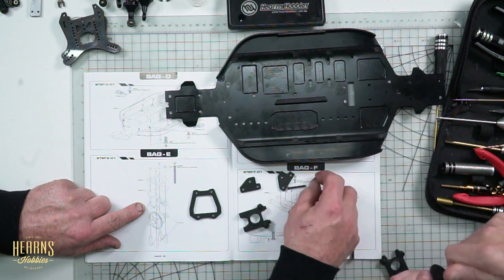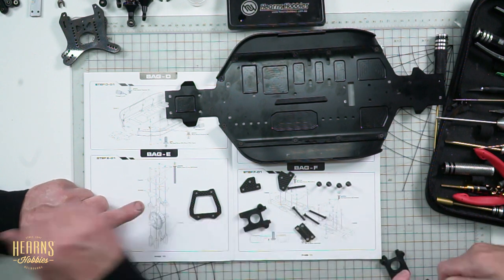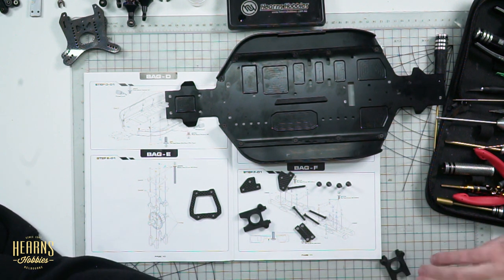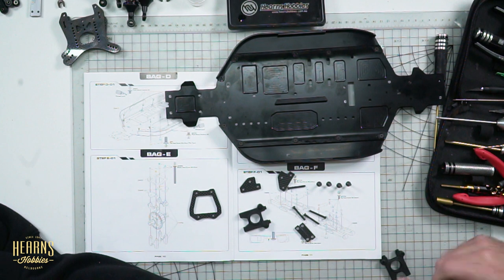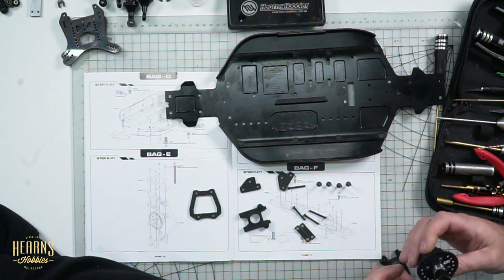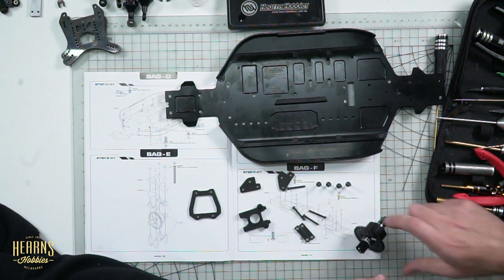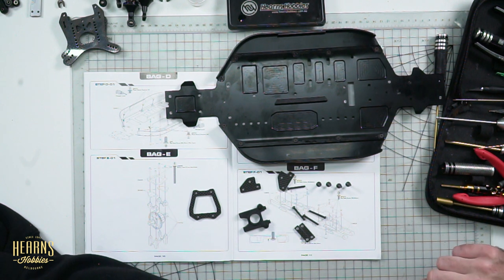Now, from episode 2, you might know that I wasn't here for episode 2. I didn't actually go with the kit setup. So you've gone your own way a little bit. Yeah. The kit setup is 5, 7 and 2. I would be going up on an oil track. I didn't build it for an oil track initially a few weeks ago, so it wasn't oiled then. But it's currently got 8 and 4 in it, which will be okay, because I'm only going to do a couple of packs and fully rebuild it. These diffs need eight front, eight centre, four rear. So you're going for a calm front with a lot of grip in the rear. Yeah, and that's going to allow me to get some horsepower down, hopefully.